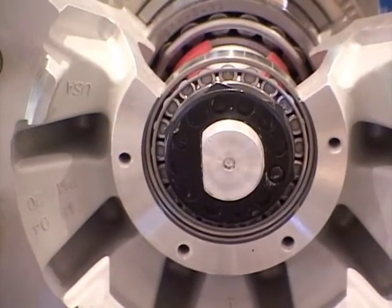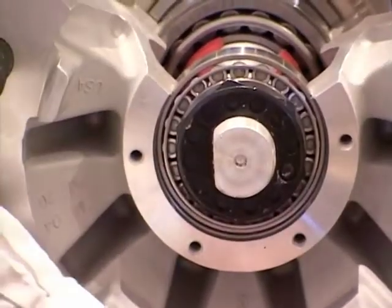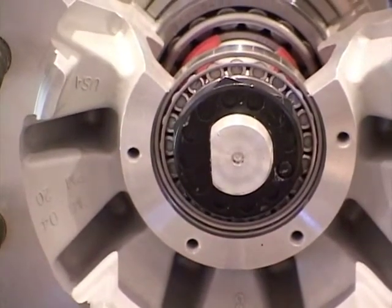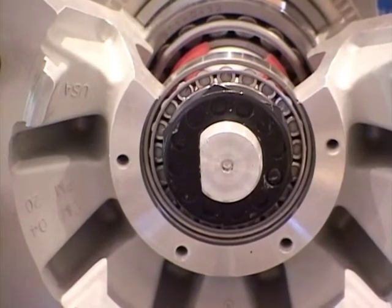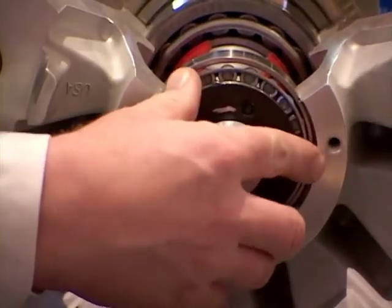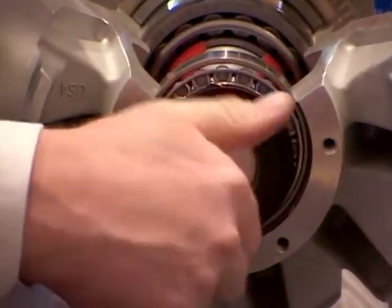In the event it doesn't fit, we only want to torque the spindle nut — no back-off — contrary to manual adjustment procedures. We want to ensure that we've got 300 foot-pounds minimum torque. We put the locking device on and torque the outer spindle nut to 200 foot-pounds.